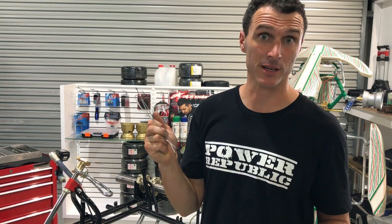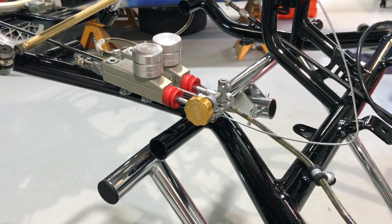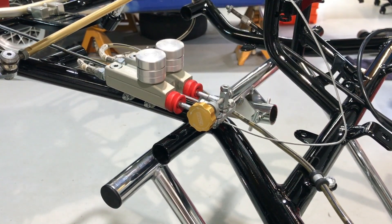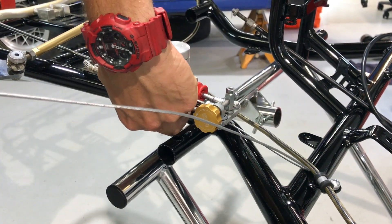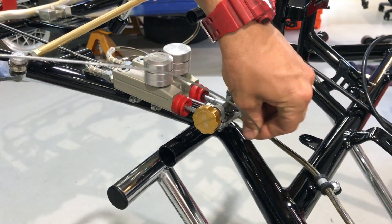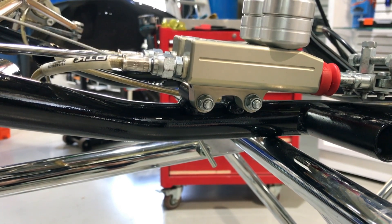Safety never takes a holiday. We've got a safety cable that has to be installed in case the brake rod ever snaps — you wouldn't want to be doing 150-plus kph and run out of brakes. Start by feeding the safety cable through the piston actuator, then underneath the brake caliper there's a small hole for it to travel through. Get it through there and pull the cable out the other side with pliers.